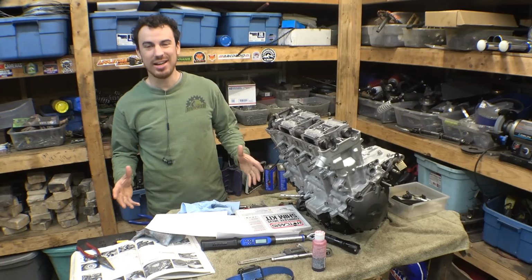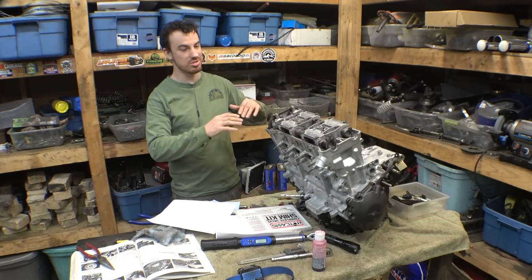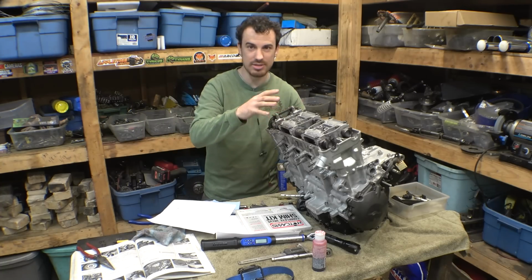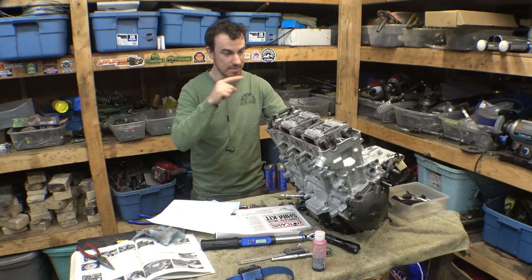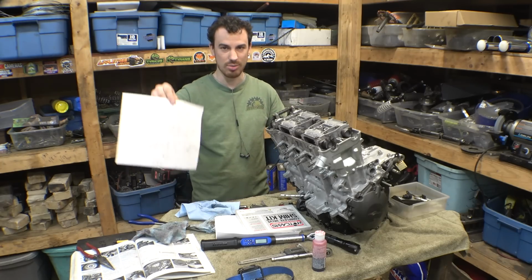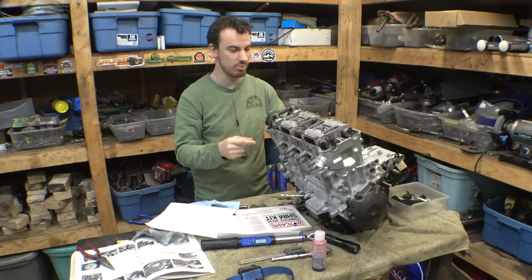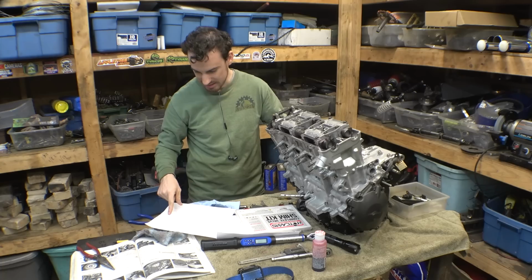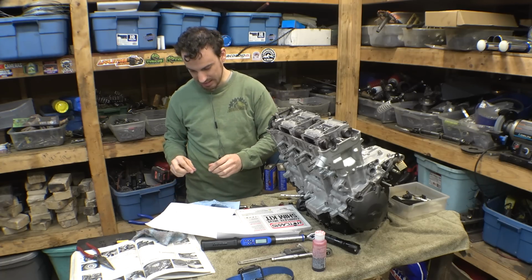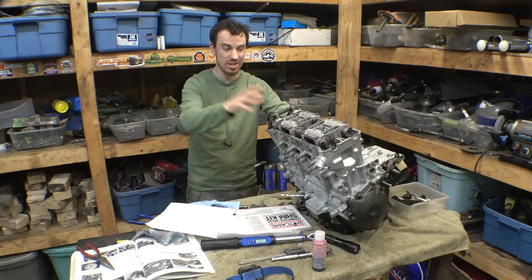Well, that was fun. Hopefully I don't have to do that again. I just spent the last 4 or 5 hours checking all the valve clearances. I didn't bother filming it because it took me forever to do. I measured all the valve clearances and wrote them down, and then I had to take all this stuff back apart so I could check the shims and measure them, and see, okay, I have to go 1.5 bigger or smaller or whatever, and I changed all the shims.